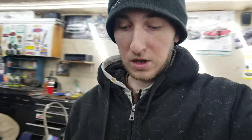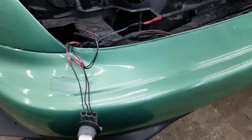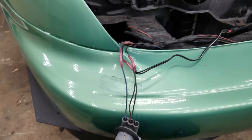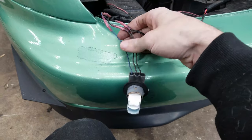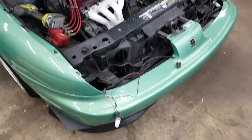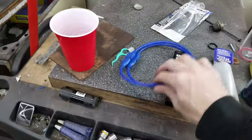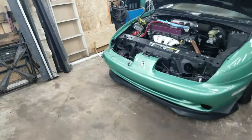I got the headlights off and this is actually going to be a little easier than I thought, because I've already wired up these headlights with a daytime running light — they're constantly on with the headlights. So this is my 12-volt source and the blue wire is my turn signal, so I don't have to do any tracing. The next thing is going ahead and cutting into this and exposing the wires so I can wire them up.